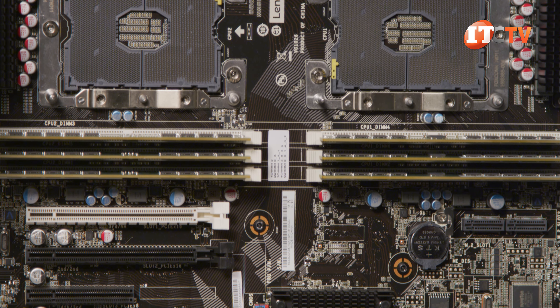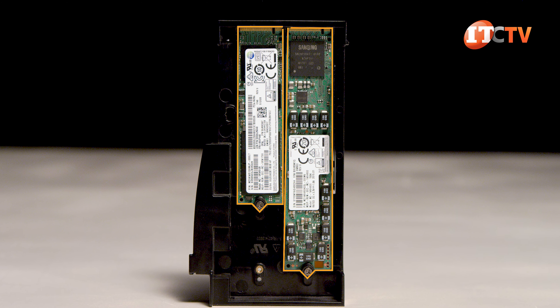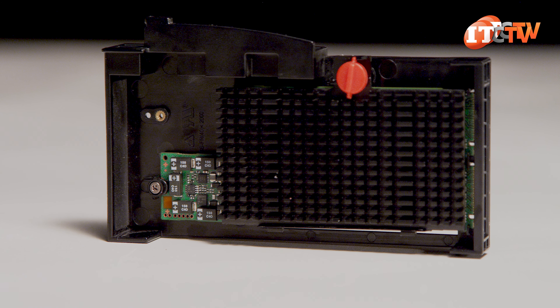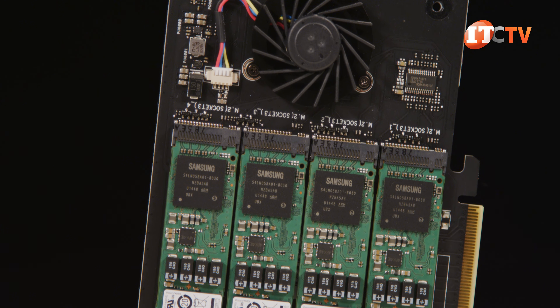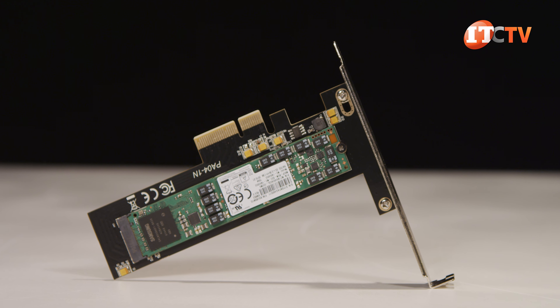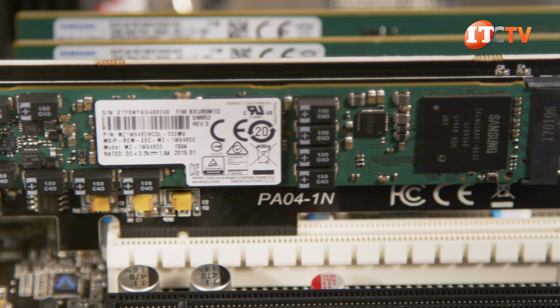Lenovo does not account for the additional storage from up to seven more M.2 NVMe drives that can be installed — and those are drives too. One or two M.2 drives are supported in a solid-state drive holder with an aluminum heat sink. The front fan assembly locks the M.2 holder in place and is also used to secure double-width graphics cards. Four additional M.2 drives can be installed using a full-height full-length x16 PCI adapter card. The other three supported M.2 drives are installed in separate PCI cards with one drive each and cannot be RAID-ed together.